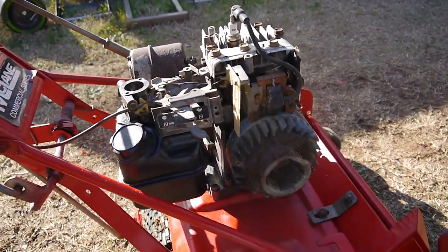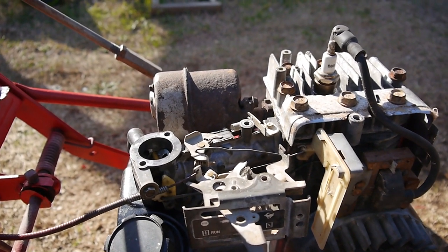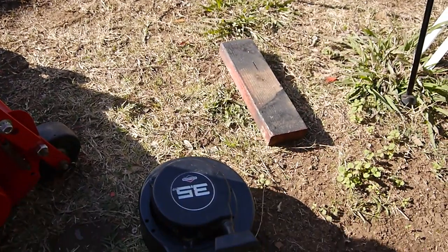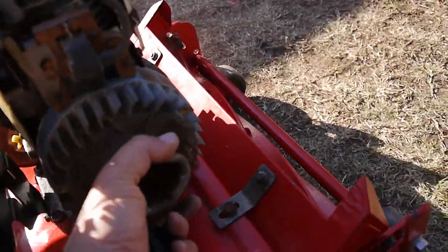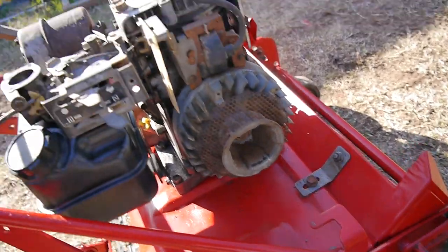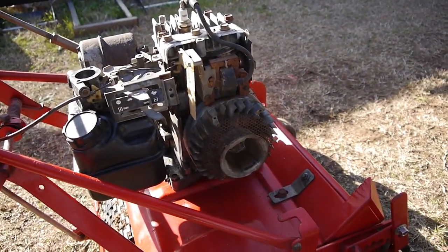All right, so this is interesting. I took the carburetor off, cleaned it out. There was a jet, that little needle valve, that needed cleaning. I got it going and it tried to crank again, but when I was trying to do the pull start, it kind of jammed. I was like, what the hell? So I took it off and freewheeled it, and it was doing fine, and then after half a dozen up to ten pulls, it jammed again. So I had to take the cover off. I'm looking at it, and I'm going to take a look at the flywheel key. I want to see what that looks like, because this is doing some weird stuff.